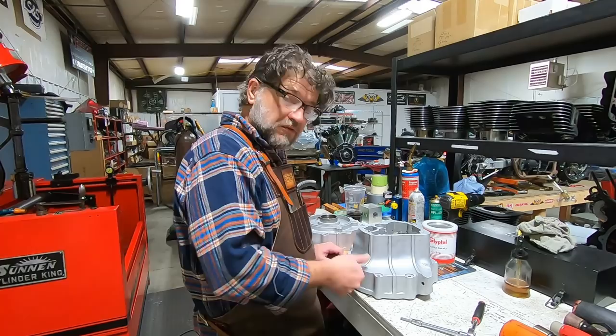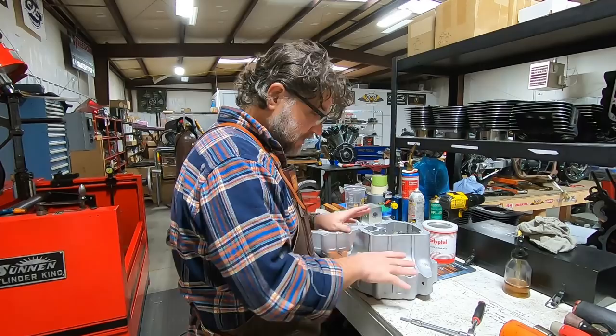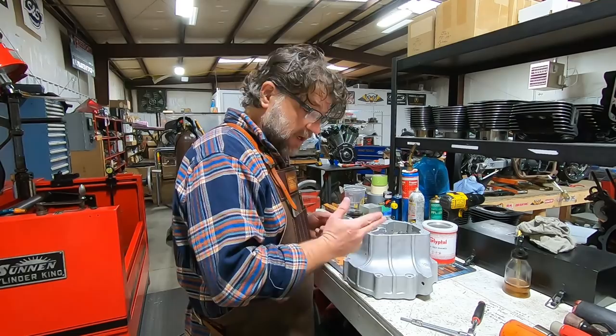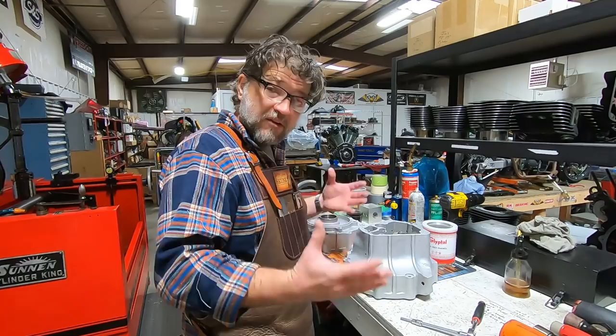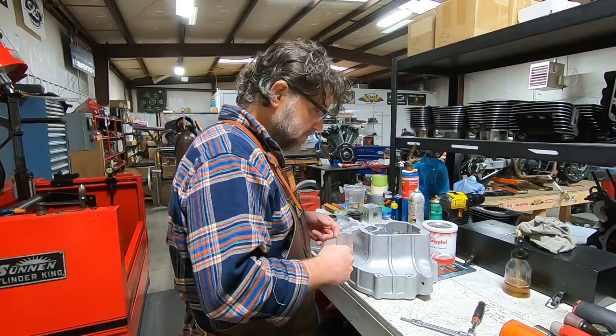All right? So what we want to do, we want to make sure our hands stay very clean and we're working with microfibers. Keep your hands very clean so you don't leave fingerprints and stuff on that natural aluminum. And if you happen to get something on there, just take a little bit of brake cleaner and wipe it off as quick as you can so it doesn't stain it. And then, of course, after we finish building this engine, it's going to sit for a little while, again, forming a bit of an oxide layer. You want to catch it before it starts turning white. As long as you're in normal conditions, it really shouldn't do that. You know, outside salt air, that sort of thing. So it shouldn't do that. And then you can spray it down.